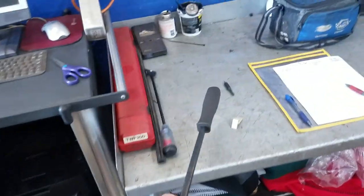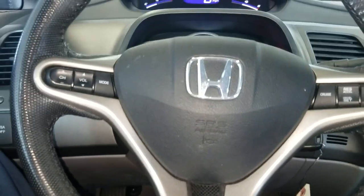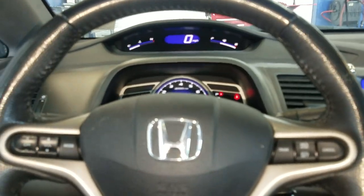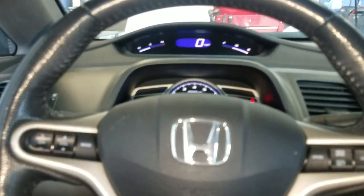I was just taking my pry bar, tapping it, and it would come on. As you can see there's a three-pin connector — I just probed the center connector to find out if we had power or not. Even a lot of times if you've got the AC on and it's lighting up saying the AC is working and your fans are on — because when you turn your AC on the cooling fans are going to come on automatically — but you don't see the AC clutch on the compressor engage, just try lightly tapping it with something. Be careful because obviously it's spinning, but give it a light tap. If that compressor clutch is getting weak, a lot of times that light tap will be enough to kind of get it going again, and then if it's working, you know what your problem is.